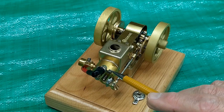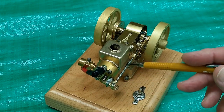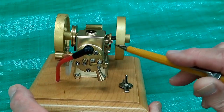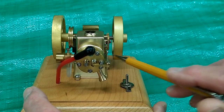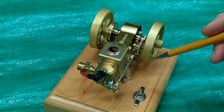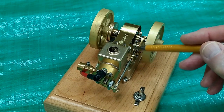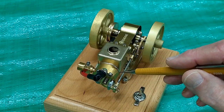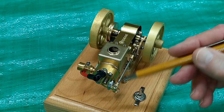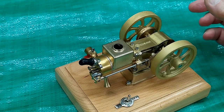To fix this, I'll have to take the head off. When I disconnect the fuel line and spark plug wire, the head will come off and the push rod will come out. This push rod goes into a pocket, and the follower rides on the cam. That will come out, then I'll take these four nuts off, remove this from the base, push the liner out, determine the O-ring size, install new O-rings, and put it back together. Not a big deal, but something you should be aware of and willing to do if you're going to work with these engines.